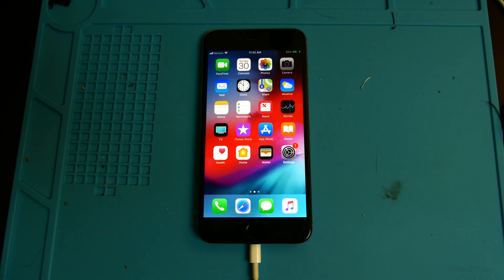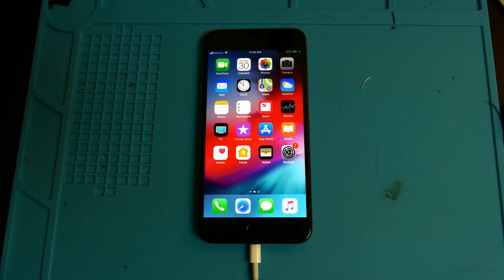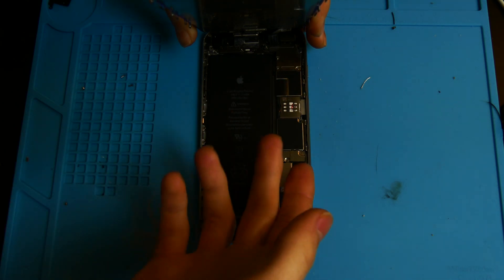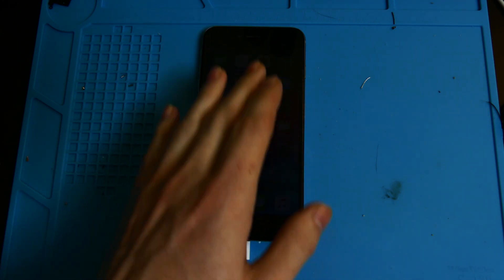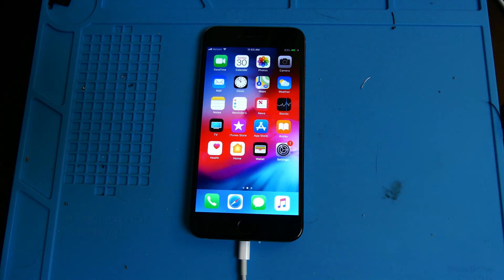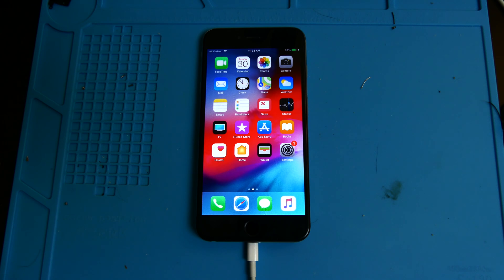I brought this phone back to life — it was completely dead when I got it, no power, wouldn't boot up, battery was bad. After replacing those parts it's back to life. Now just trying to resolve the signal issues. If you guys have any suggestions, a lot of people are saying baseband CPU, but I don't think it's that since there's really no evidence of water damage on the top of the board where the baseband CPU sits. The water damage was mainly on the right side — it likely entered through the SIM card tray. The SIM reader is working fine and recognizes all SIM cards. This has been Colinwood TechOut — don't forget to comment, rate, and subscribe, and as always, have a great day.